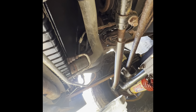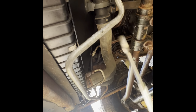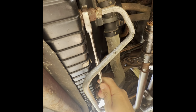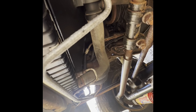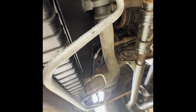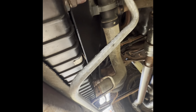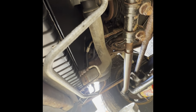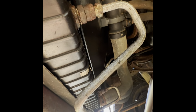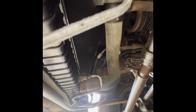What size for the fitting on the radiator? I think it's 22 millimeter — I got a 24 and it's a little too big. You're going to use an adjustable wrench or even a pipe wrench, whatever you've got, just to hold it in place. If you try to turn the line fitting, that radiator fitting is going to want to turn too, so you can also use channel locks to hold it — remember you're just holding it. So 18 millimeter for one side in my case, and 5/8 for the other.